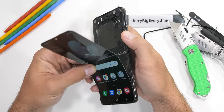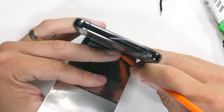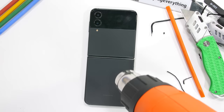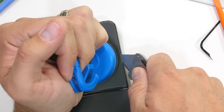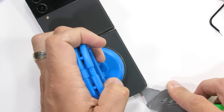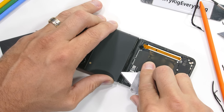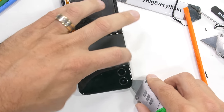Honestly, I think we might have just been successful. It's still plugged into the motherboard of course, but the hardest part is over and it just might live another day. Heat again is our best friend, and with a suction cup and our trusty green razor blade, we can separate and lift the glass panel away from the body. The adhesive is mostly just around the perimeter. I'm taking special care not to let the tip of my blade point downward so we can avoid slicing the battery or damaging any circuitry. The secondary exterior screen is also removed the same way, taking extra care not to stab the edge of the screen under the glass, since that never ends well.